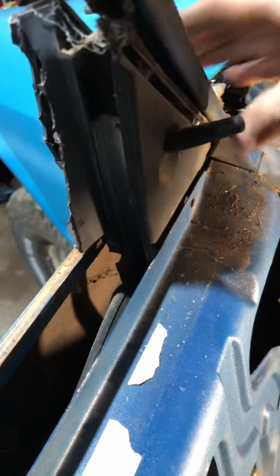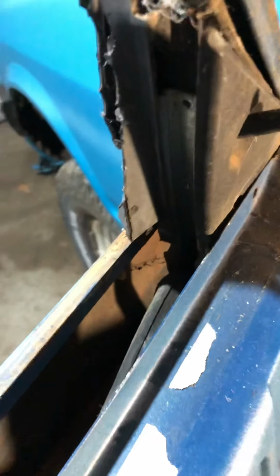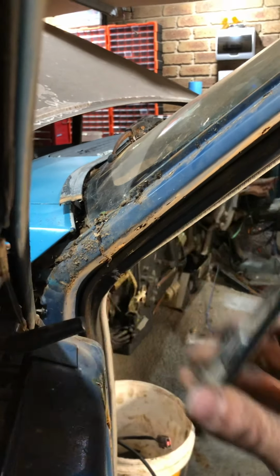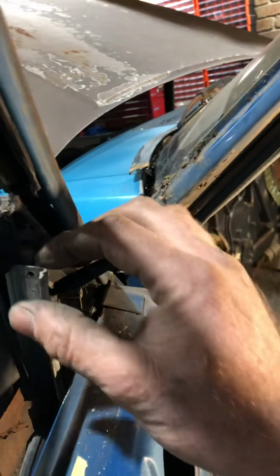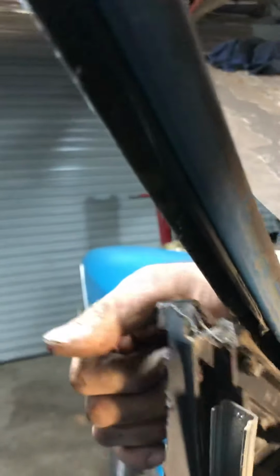Once you've slid it out a little bit, you should be able to take off the cover. Nice and easy. It's a little bit difficult one hand. Pop off the cover. This little metal part, you want to separate this from the mirror. See how the mirror is just kind of going one way? Separate that metal. Once that's out, you'll be able to pull the mirror straight out. So you can pull that back a bit. Sorry. Like so. The mirror would come out.